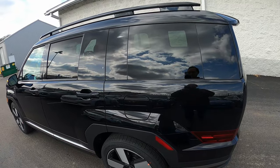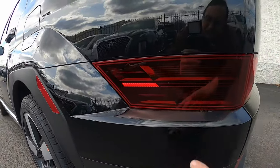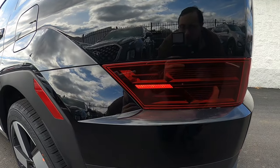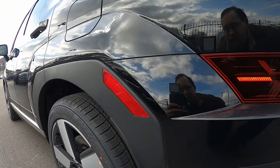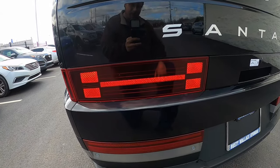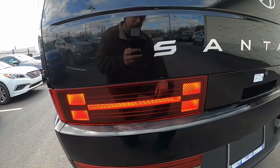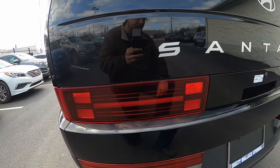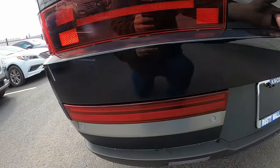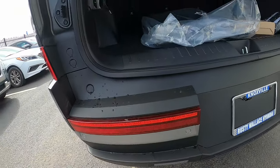Moving around to the rear, there's a big piece of red taillight plastic at the corner that's mostly for style but also houses the side marker lamp. The taillights continue the H theme. Interestingly, they're mounted on the lift gate, which goes against federal regulations saying tail and headlights can't be on moving body panels. Hyundai gets around this by adding auxiliary lights — when the hatch opens, the lighting transfers down to that auxiliary strip, and transfers back once it latches.